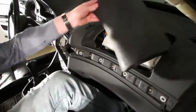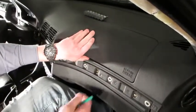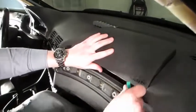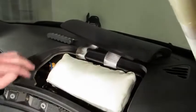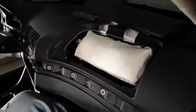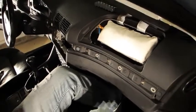To get the airbag cover off, stick a small pry tool up underneath — be especially careful if you have the extended leather dash, as you will harm the leather if not careful. Use a towel if you have extended leather. Pop the cover upward and it comes off. You don't need to cut the straps as some people say — just unbolt the airbag, remove the wire clip, and remove the airbag from the car. Be careful — it contains explosive devices. Be wary of static charges.